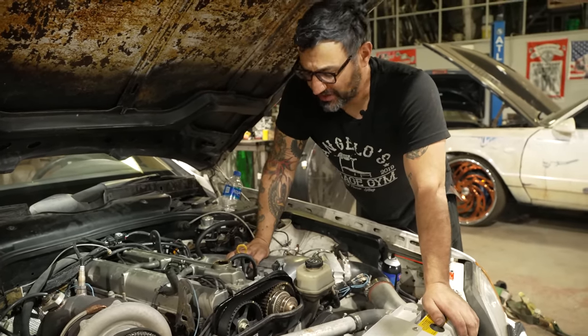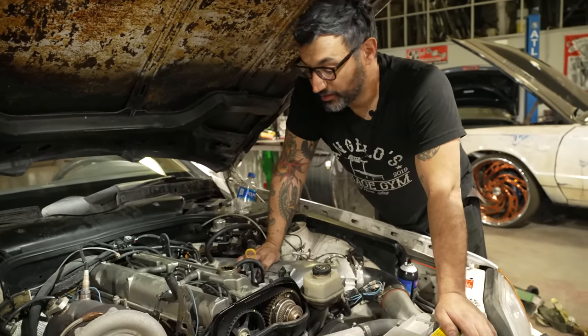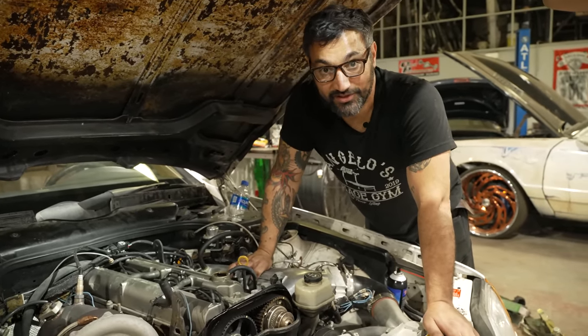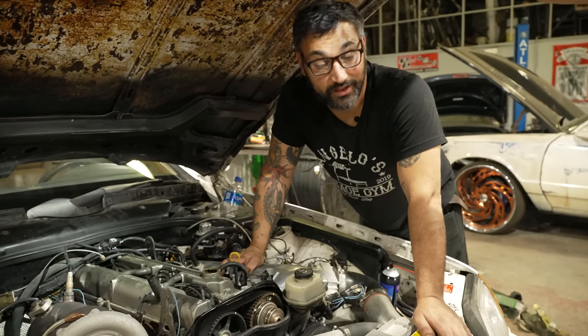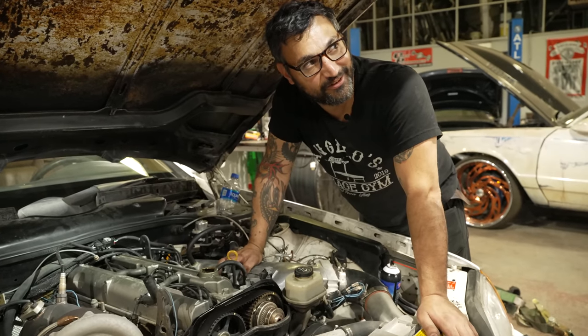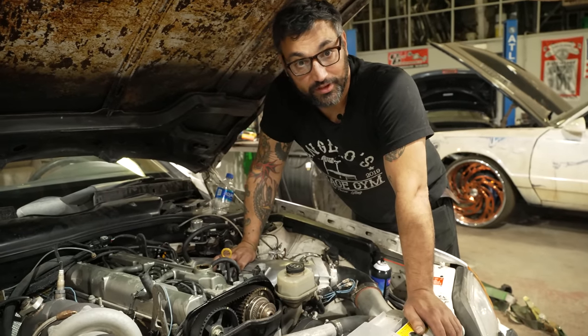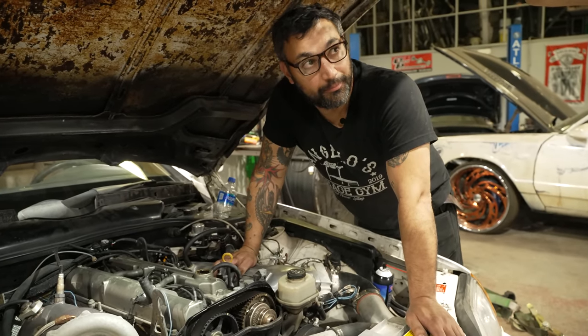But hopefully just fire it up, hear it. We know, I'm assuming from a bunch of crankcase pressure, that we blew the front seal of the crankshaft out. And it's going to just spew oil everywhere. So I don't know, do you want to do like a real quick dyno run, or how do you want to do this? It's got to get fixed before we can really drive it, but I'd like to hear if it's running on six cylinders and kind of get some hope back in our lives.